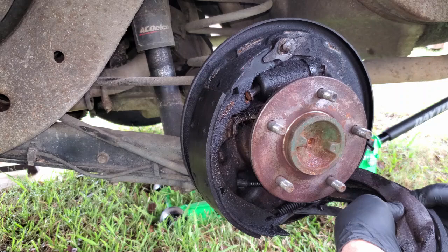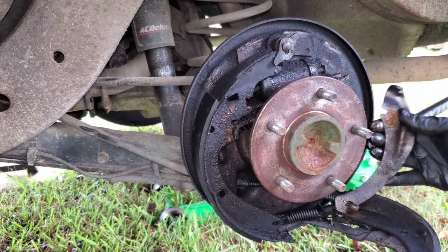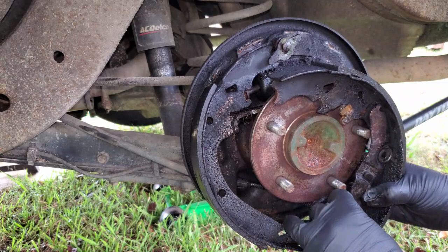Twist your brake - your emergency brake lever usually pops up fairly easy. It's not often I do drum brakes, thank God. You just pull up and twist and it'll come right out. See all that brake fluid in there? We'll just let that guy hang. This is our brake adjuster - pull a spring out of that, pull it this way so you can see it.